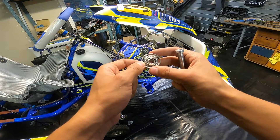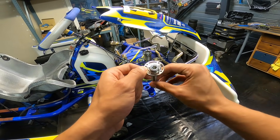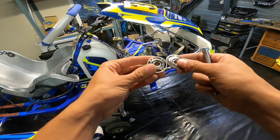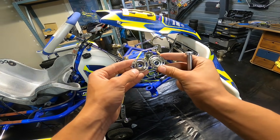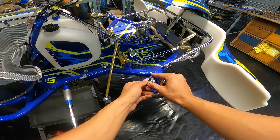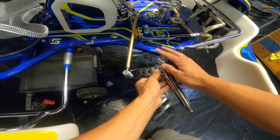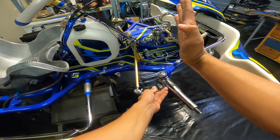For that, they have invented the eccentric ring. This is a five-degree eccentric ring, which means the hole for the kingpin is off-center by five degrees. You might not be able to tell, but if I hold a zero-degree ring next to it — which has the hole in the middle — you can see there's quite a big difference. If we put the five-degree eccentric ring in and push the kingpin through it, you can see we now have five degrees of caster because the hole is towards the back, tilting the entire stub axle that way.